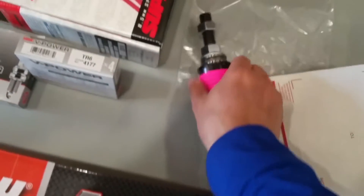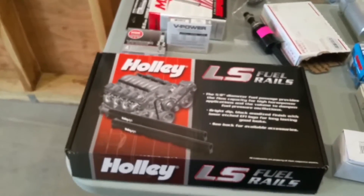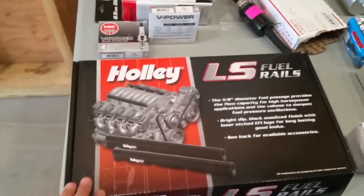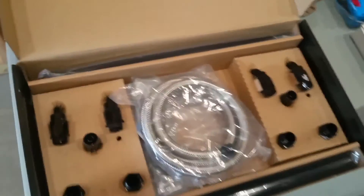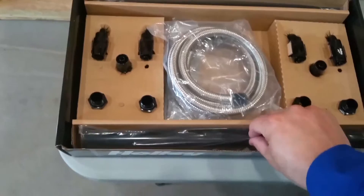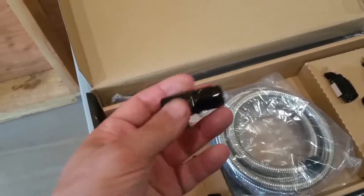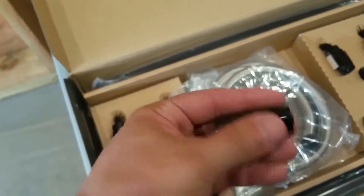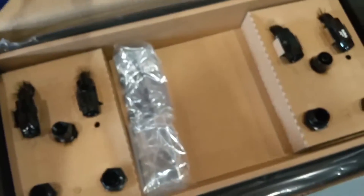Over here — I mentioned wanting to upgrade to E85, but I'm not certain I can do that since very few gas stations near me sell it. Anyway, I got a Holley LS fuel rail kit in billet aluminum. I did a lot of research and most companies just offer the fuel rails and leave you to source all the fittings and lines, but this kit has everything. It's a 6 AN fitting, comes with all the connectors and elbows you need, six feet of stainless steel braided hose, and all the brackets.